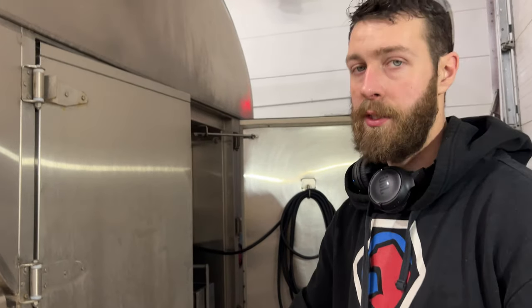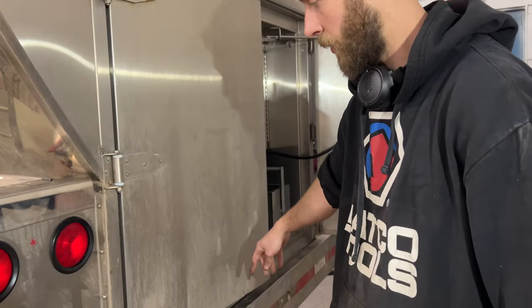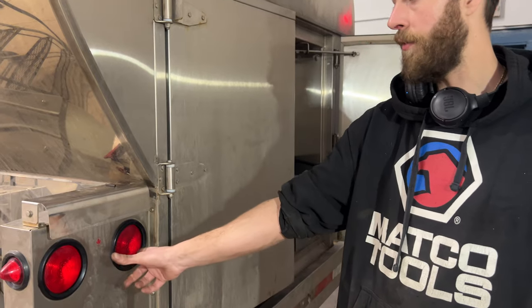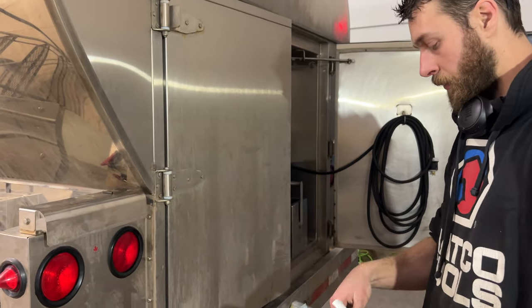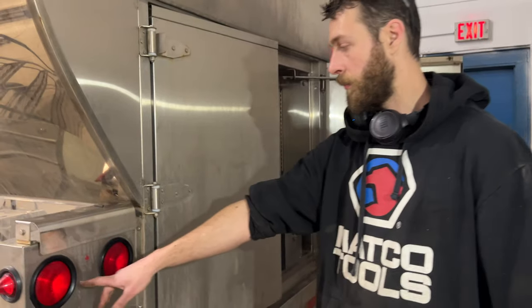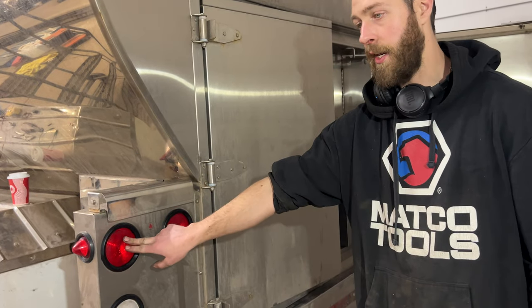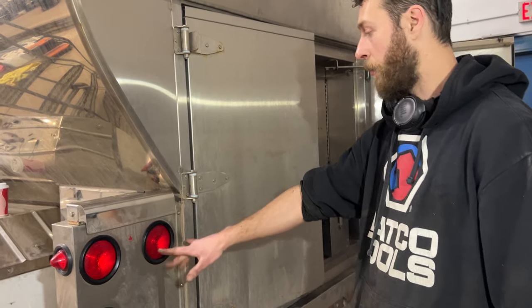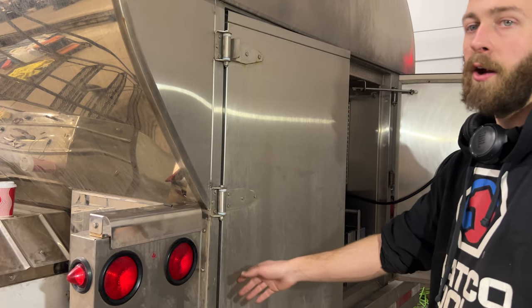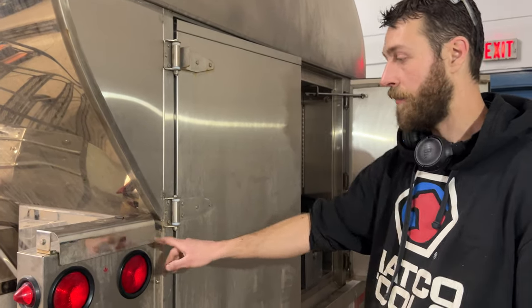I was trying to figure out how I could wire up brake lights to this thing. The way they have it wired, your turn signal wire comes up and just splits off to both lights. I thought we could just do one turn signal and one brake light, so this one is dedicated for turning and this one is just dedicated for brakes — but I wanted them both to be able to work as brakes. When you go to slow down and turn left, you could turn the signal on and the brakes would be working on that side.